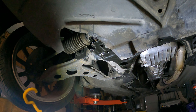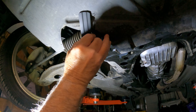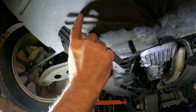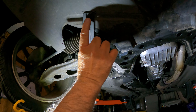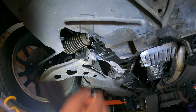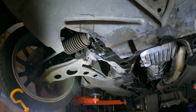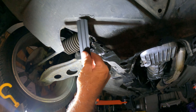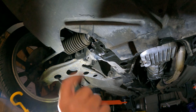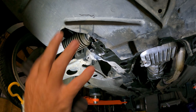So what I'm going to do now is take this piece of plastic — I've got it set up with an outline right there — so the plastic will sit there and be able to push into place to hold this up. The idea is to keep it from flopping down, and I've only got this up here with a couple of bolts anyway. I'm going to pull this back off, turn it upside down, plastic weld this piece to this piece, see if I can get it to stay on there good, and then with the hole drilled in here, pop it back in — that should hold this all up.